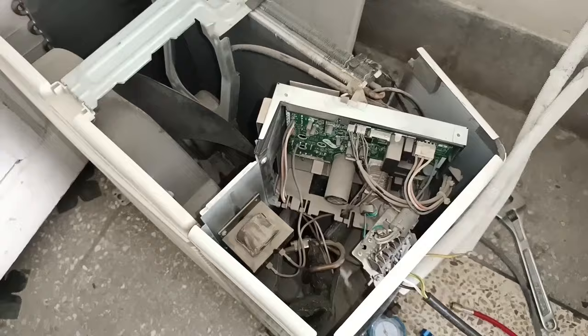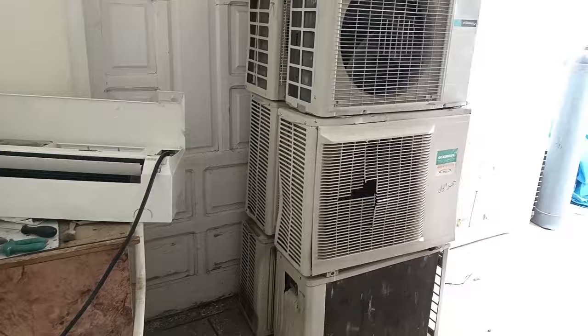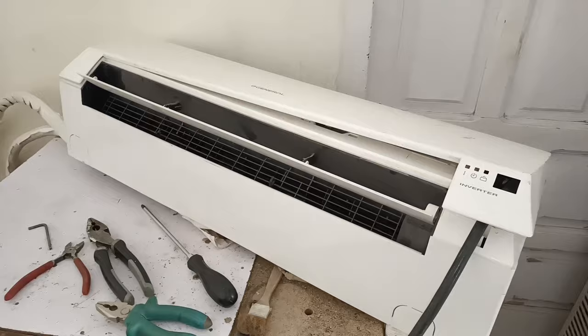Let me explain in 2 ways. The first is that it works for 15 minutes and then stops. Why is it doing that? I have installed it in my workshop, which is an open area and a quite big room. Since I've installed it here for testing, the unit is under capacity according to the room. When this unit starts, the temperature of the sensor should go down. If the temperature does not go down, then the air conditioner will go on and off repeatedly. The circuit board will think the air conditioner is not cooling because the sensor's temperature is not changing, which means it is working normally.